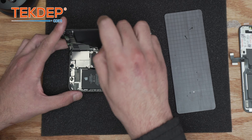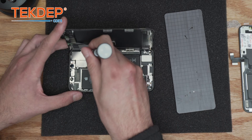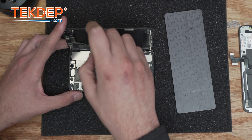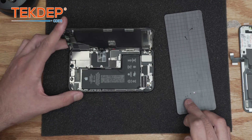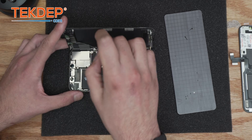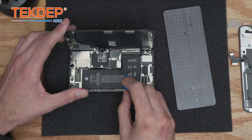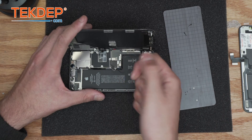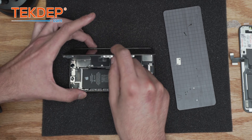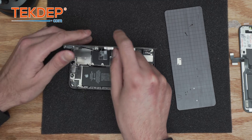Number two, it's also a safety measure. You don't necessarily need an ESD strap as long as you follow the steps and protocol, but I prefer to be safe rather than sorry. Once that's done, you can use a guitar pick — most people prefer a spudger but I like a guitar pick. Disconnect the battery, then press the power button to make sure there's no charge on the phone. This is the best way to discharge it.